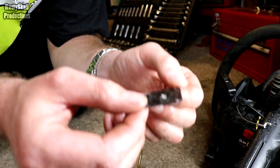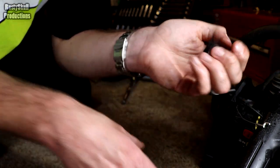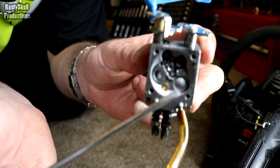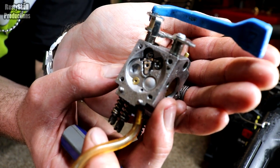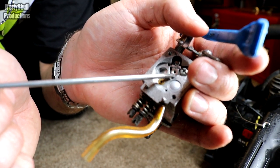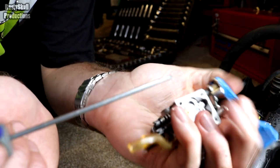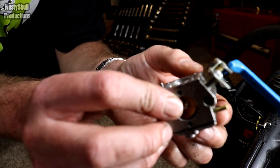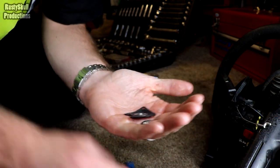It's gone and fallen off by itself - there's a gasket, the gasket's attached to it. But that's basically all it is, and this is actually giving me a good chance to show you what's inside it - I didn't show you in the other one. So we've got ourselves a little spring, a little needle valve that goes up and down and shuts the fuel on and off, then we've got a fuel pipe that comes in here. It's as simple as that - there's not a lot to it on these little ones. So there's the diaphragm - all had it.